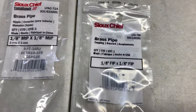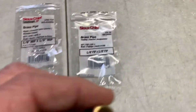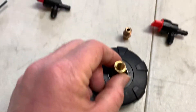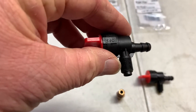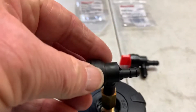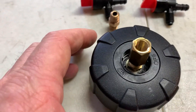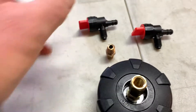Once you do that, the other thing I got at Menards is a one-eighth inch female to one-eighth inch female coupler — basically just a union. That allows you to use pipe thread compound or Teflon tape and screw it onto the top of the nipple, and then thread the Briggs and Stratton valve onto the coupler. Then you can put your gas line onto the barbed end of the valve. That way, if you want to use the cap without the extended system, you can just pull the gas line off the valve and open or close the valve for normal tank venting.